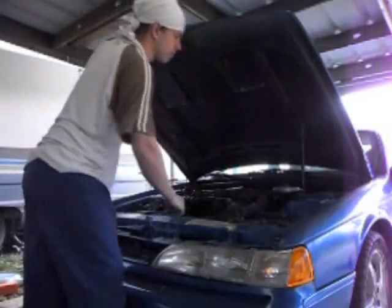First step is going to be removing the hood. As you see, my gas struts are crap. Okay, hood's off. Gives me a lot more working room. Go ahead and get the fluids drained out of the radiator. Okay. Radiator's drained with minimal spill.